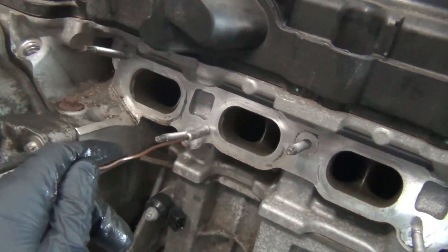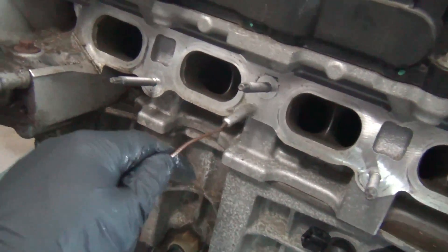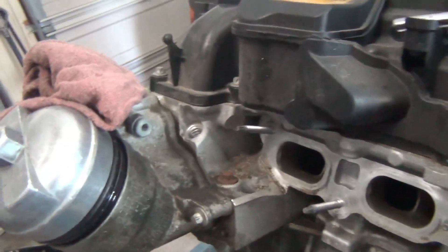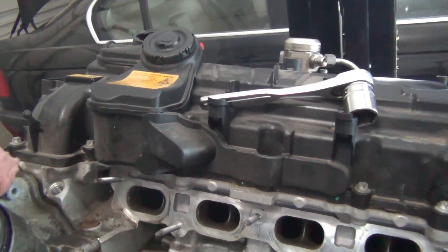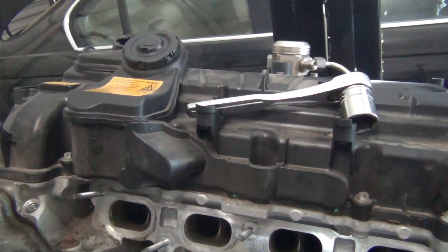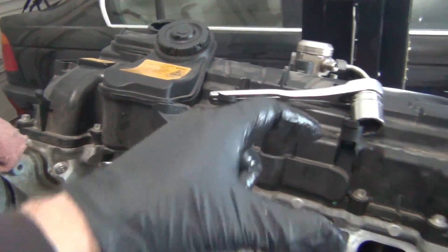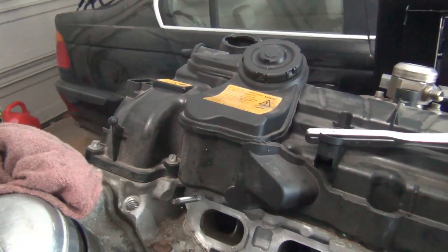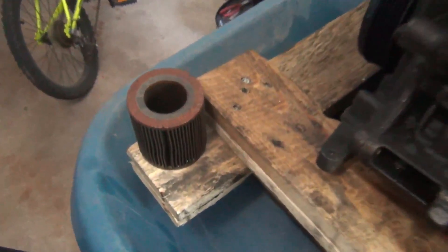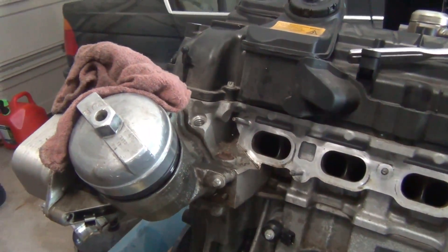Now this is an aluminum head — as you can see it does not stick, as opposed to steel — and the block as well. So there's a lot of aluminum here and that's where that material is coming from. I would expect it might be our bearing caps, which are straight drilled cam caps — basically the caps are the bearing. So we have to take a look at each cap. We're going to pull the valve cover off in the next video and take a look at the bearing caps to see if we have any metal transfer or scoring that may have been caused from top end damage due to oil pressure issues. Just a quick check — you can learn a lot just from your oil filter, so it's a good idea on every service to go ahead and bag it, keep it, and take a look at it.